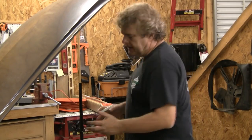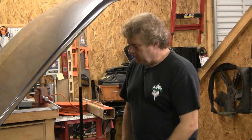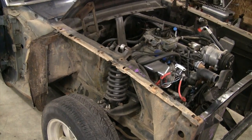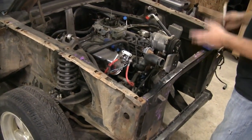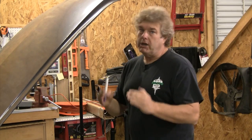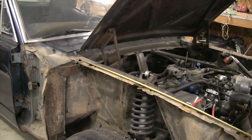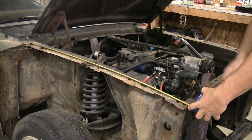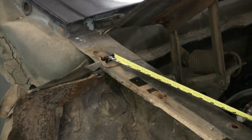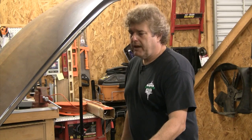Whenever you're starting to work on something like this, you might think you should just rip everything off the front end and start making a mess. Don't do that. What you really want to do is go in and start taking measurements. Once you get all the front sheet metal off and your radiator and condenser off the apron area, start taking measurements. I've already done some measuring off camera. On this car, I go to the very back, put my tape measure in there, run it up to the front, and I know that from that point to the front of the apron is 40 inches. I've also marked my position back here with a paint pen so I know which measurement point I'm at if I'm a couple of days out from finishing.